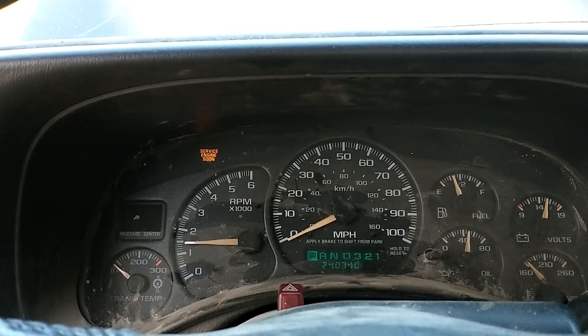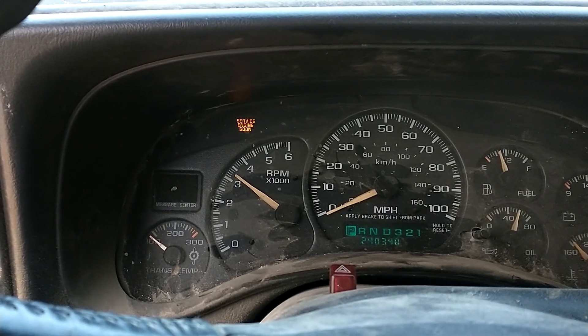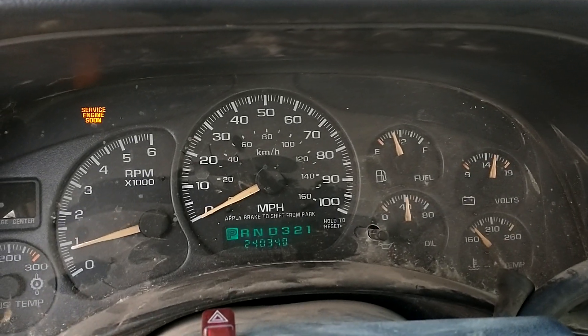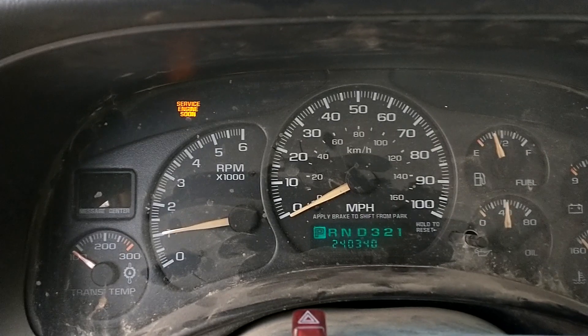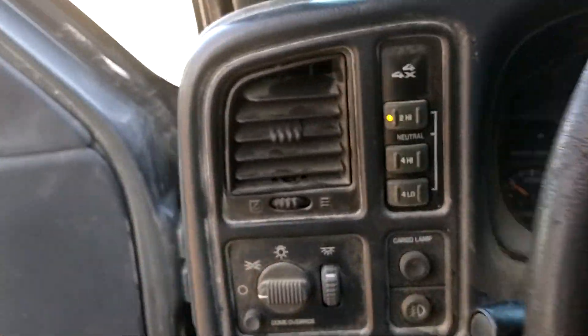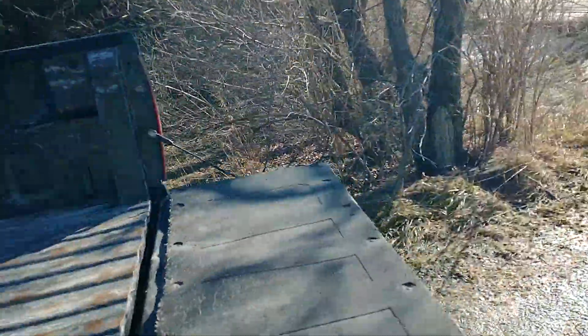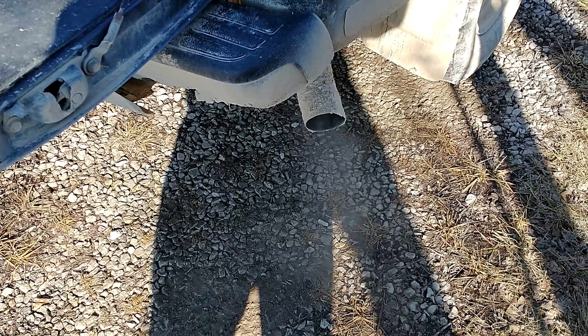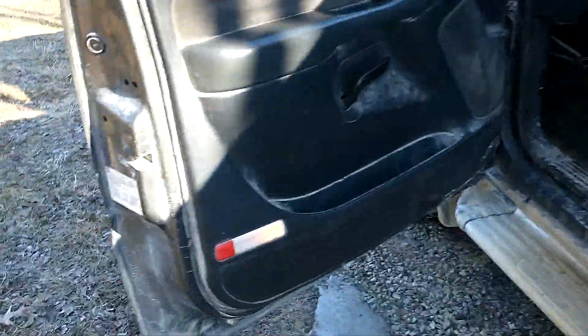It smells terrible. The other thing is — we're about to start doing it. Let's go sniff that smoke real quick and see what it smells like. That honestly doesn't smell like coolant. I think that's unburned gasoline being detonated or something in there. Now we're starting to misfire — you can really hear it chugging. I should start getting a flashing check engine light here pretty soon.